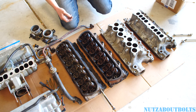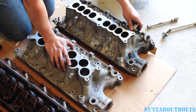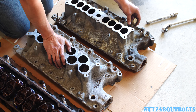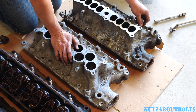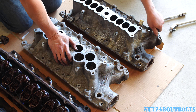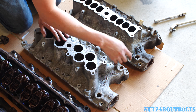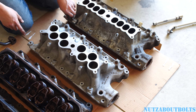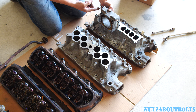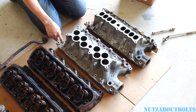Then we've got the lower intake manifolds. There are obvious differences — you need to drill and tap a spot for the ACT sensor here on the GT40 lower; you can find the thread size online, or I'm just going to take it to a machine shop. There's a temperature sensor location that's already in place, and then there's the heater pipe fitting which is the same. There's also a small coolant fitting that goes up to the EGR spacer — you'll need that to have everything back to stock, so we're going to tap that out as well.